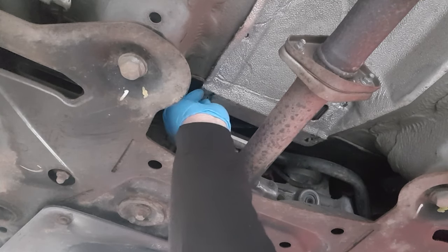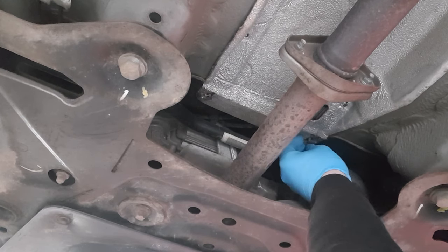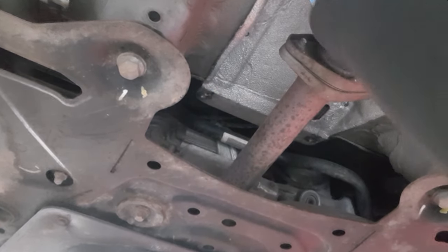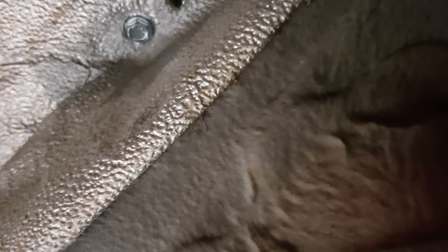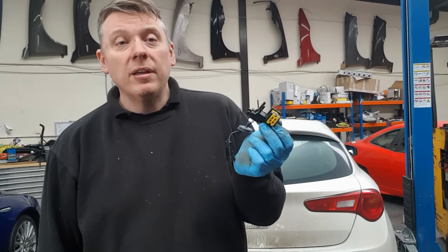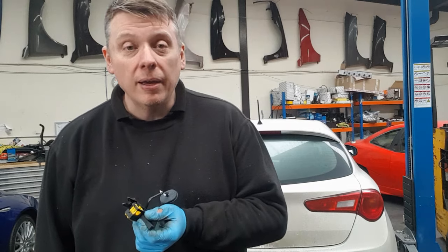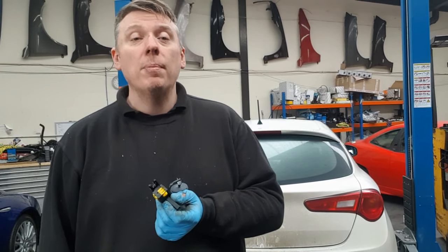Now these two clips should just push back on. Just make sure I've tightened everything up. If you've removed your rivets and you've still got the ends in there, if you're very lucky you can get away with putting a tech screw in there - a small tech screw - which means if you ever need to remove it again it's going to come off a lot easier. I've managed to do this with all four, so I haven't needed to put any new rivets in. You can order just the rivets as well if you want to replace them. So that's the stop/start sensor replaced on the Giulietta. It is quite a pain of a job and I wouldn't really like doing it on my back on a driveway, but it is possible. You've seen all the tools you need and how it's done. If it helps you out, please give this video a like and a share, and if you do like what I do, please give me a subscribe. I'll see you in the next video - thanks for watching.